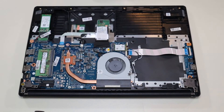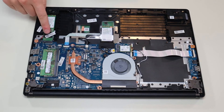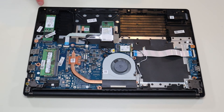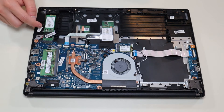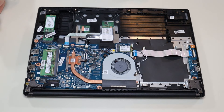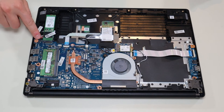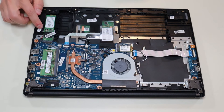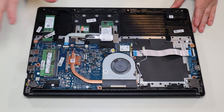If you're looking for a replacement 8GB RAM stick, I'll have options in the link below. Your CMOS battery is right here underneath your solid-state drive, so it may be safer to remove the SSD first to access it. It's held by a single screw, pulls out of its port, and is held down by double-sided tape. It plugs into the motherboard right there. If you're here to reset BIOS, you don't need to physically remove the battery — just unplug it for 15–20 seconds and that should be sufficient to reset your BIOS system settings.